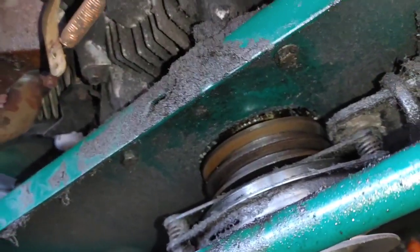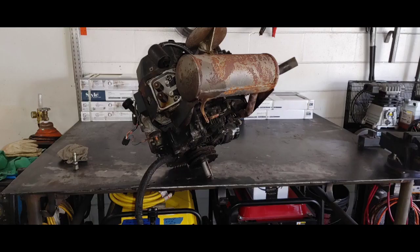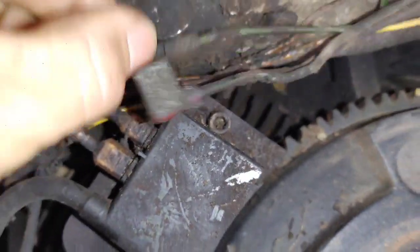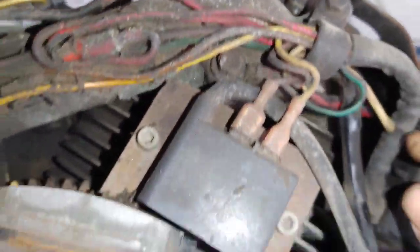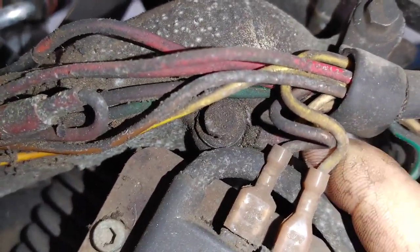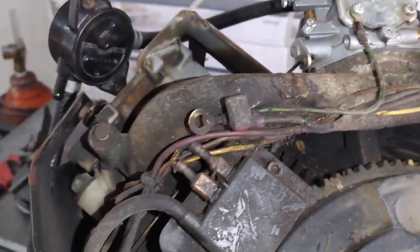I got the engine removed - this is a good opportunity to clean up all that engine bay area. I put it up on my table, and as I took the shroud off I'm seeing stuff that wasn't put back together right. Ground connections not hooked up properly, a bolt right here that's loose on the intake - really loose - so that was probably creating a vacuum leak. Just a lot of mess on these older mowers that people have worked on.